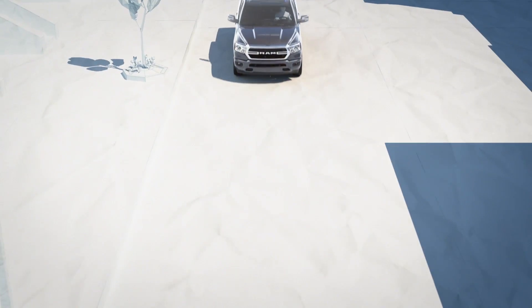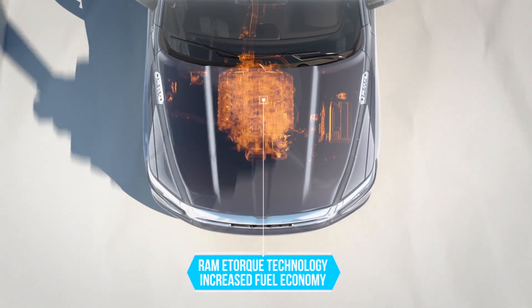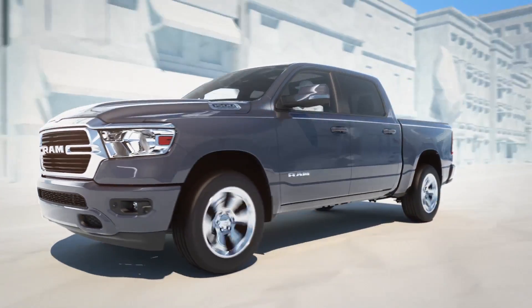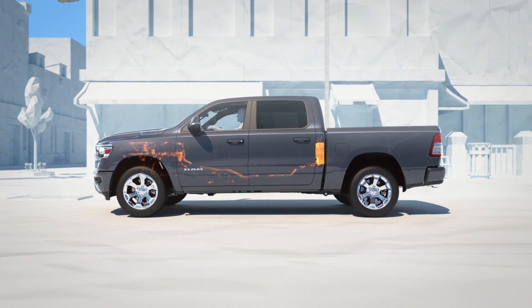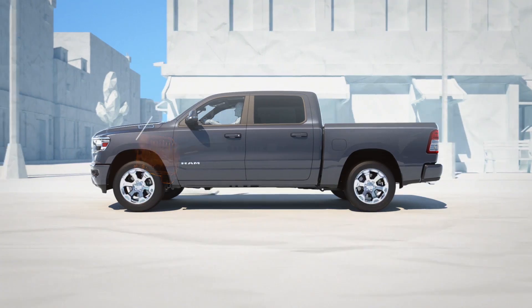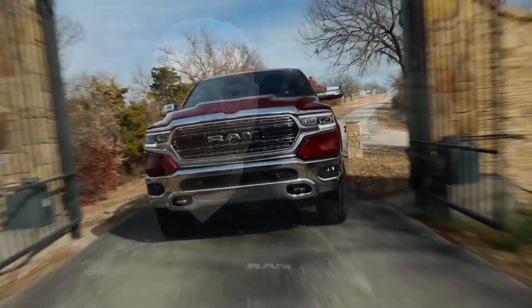One of the biggest benefits of all hybrid systems is recovering vehicle momentum. This is done through regenerative braking, using the transmission, engine, and motor to decelerate the vehicle and displace the braking function normally handled by the friction system, through an overlay braking regenerative architecture. That recovered energy is then utilized for auto starting, acceleration, and other hybrid functionality, offering further fuel savings.